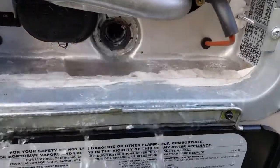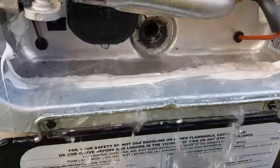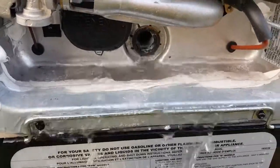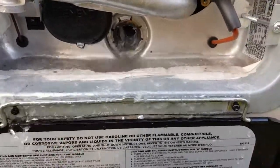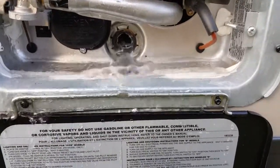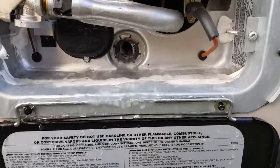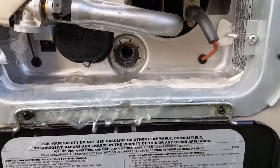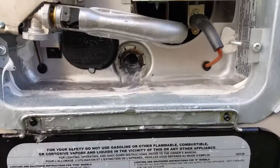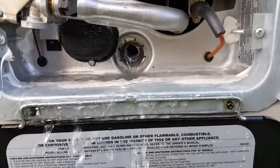You can see some of the corrosion and minerals that came off the anode rod in the water as the tank gets low. I didn't camp a full season this year, so I'll replace the same anode for now. Once the tank is fully drained, I'll make sure it's back in good and tight. I may install a new anode rod in the spring just to be safe. They're not expensive.